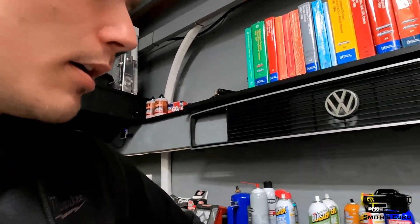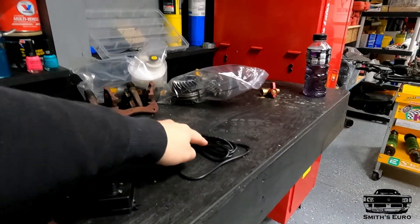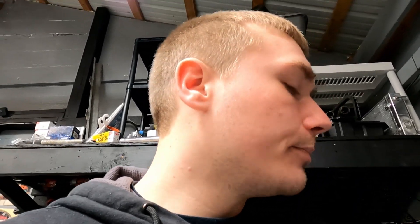When you buy this it's like $350 or $400 maybe now, but all you get is this harness and a serial connector cable. You have to have an external MAP sensor on this — there's not an internal one. You also have to tune it yourself. You can get Tuner Studio Light, or you can pay — I think it's $60 and you get a lifetime subscription to it.